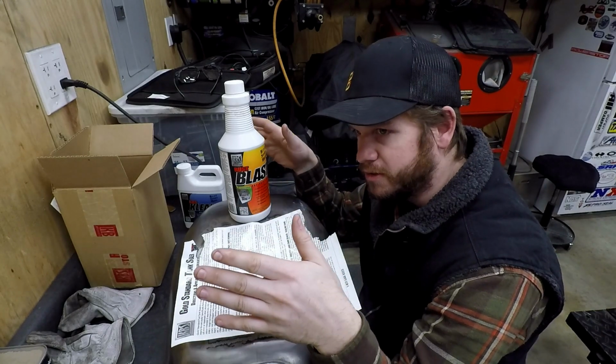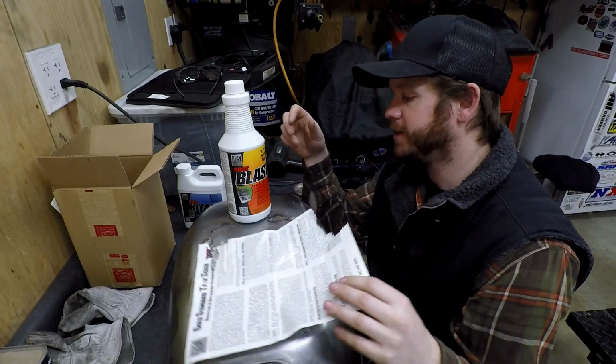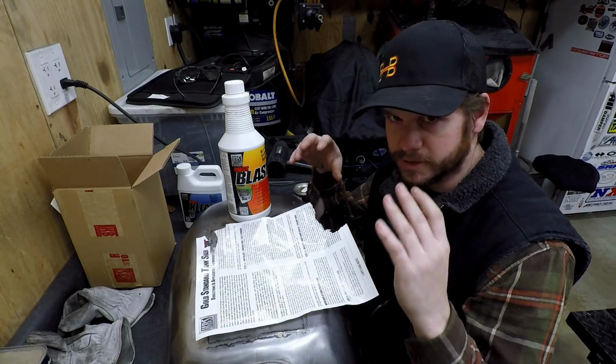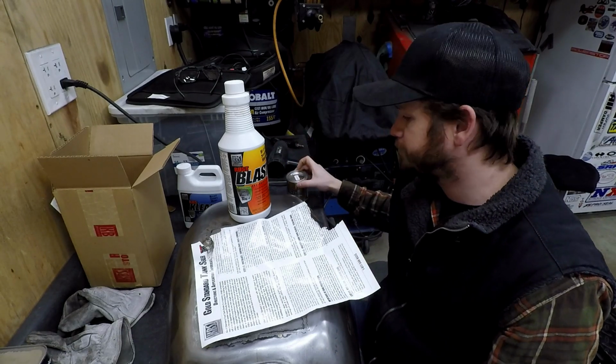Once it's etched, you're going to rinse the tank out again. Just keep rinsing it, and then you want to again air dry it. Now in that instance, you might still see a little bit of oxidation or white powder. That's okay. It's just being etched. That's normal. But you just want to make sure it's completely dry again before you go for the tank sealer.